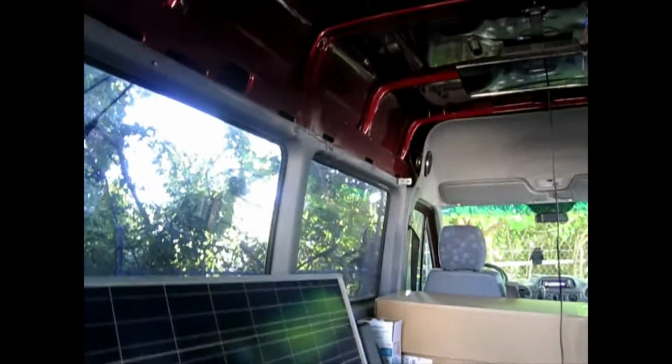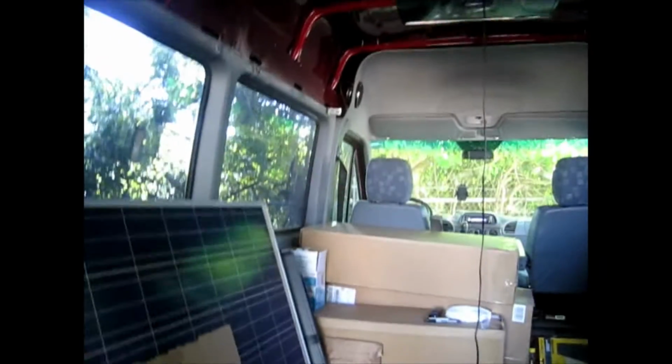Also, I'm going to put my own 12 volt lighting in here instead of the RV lights, which will be there because they're original. But I'm going to do my own 12 volt lighting, which will go straight to the fuse panel again on a separate switch. I think I'm going to separate the back lights onto a separate button back here somewhere, and then the other 4, I'm planning on 6 little LED cans, the other 4 will be up there, and that'll come on all together with one switch. Boom. As soon as you walk in the door on this side, it should be on that sink cabinet or something like that.